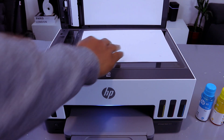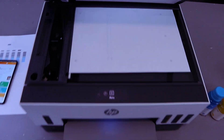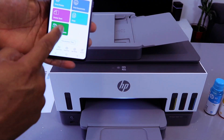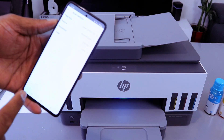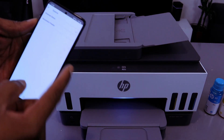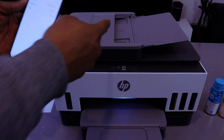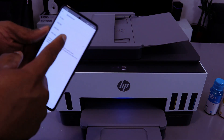Place the document face down, making sure it starts from the top left side — it's A4. Then close the cover. From the HP Smart app, select Printer Scan, go to the top, and select page size as A4 and source as Glass Scanner. If you are scanning from the document feeder, then you select Document Feeder.